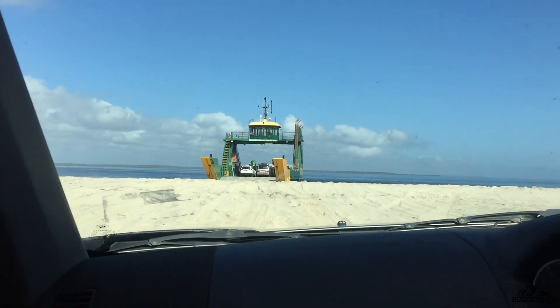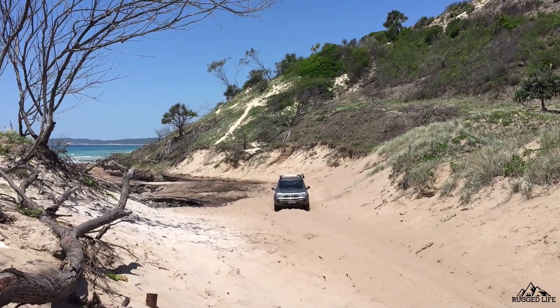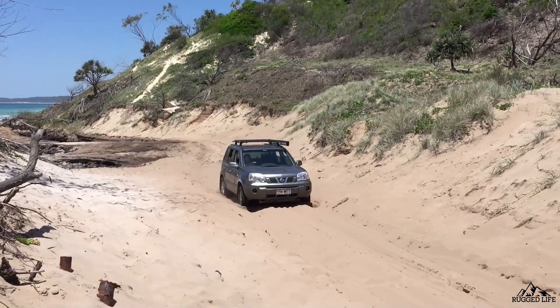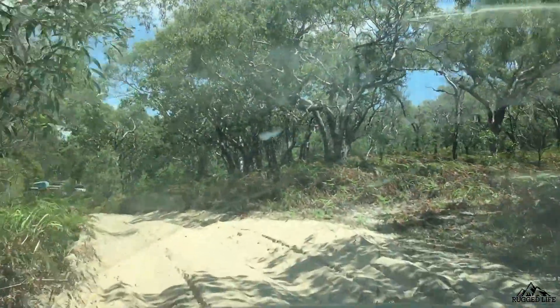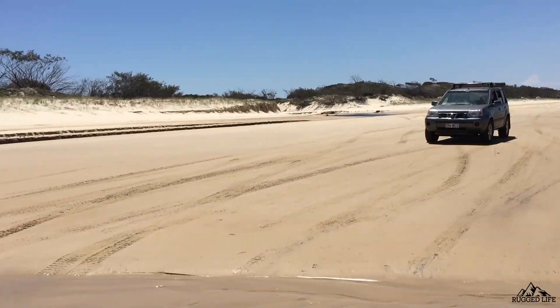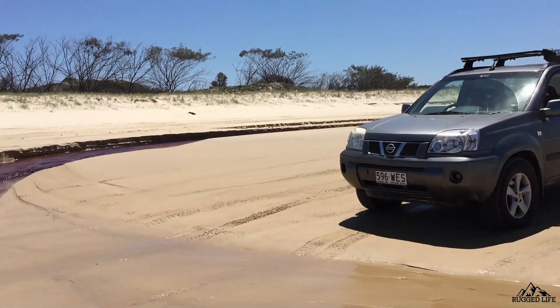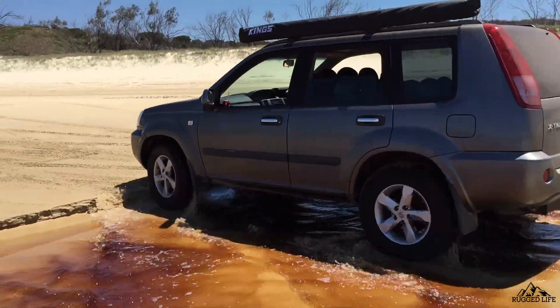For sand, it performed quite well, but when driving on sand it's more likely to be your tire pressures that give you the most traction rather than the actual tread. The 235-width profile tire on this vehicle is quite wide — I highly recommend choosing a narrower width tire if you plan to do a lot of sand driving. There's a link in the description to my practical four-wheel driving playlist with a video about tire pressures.